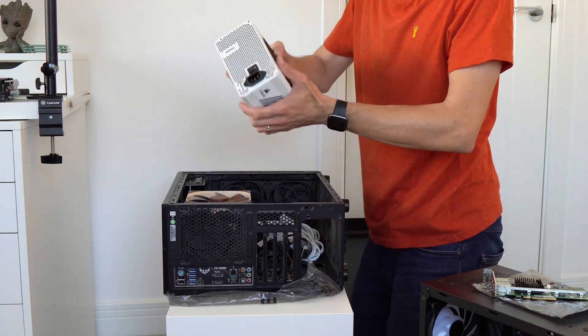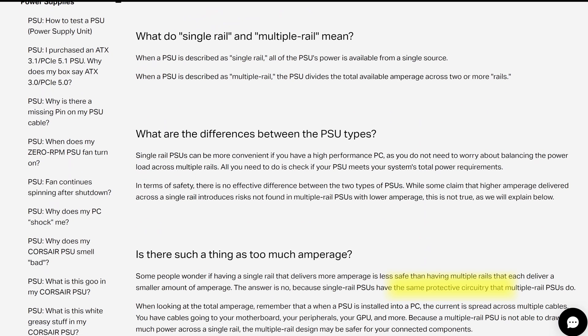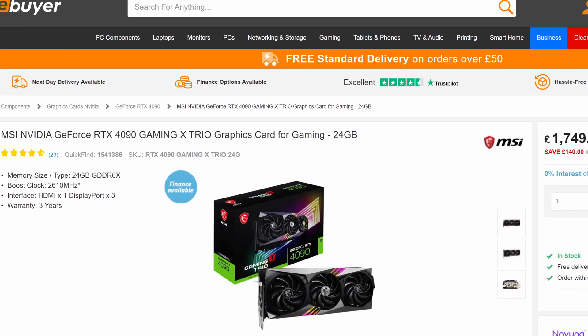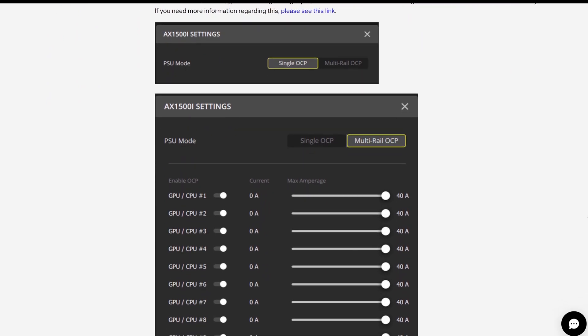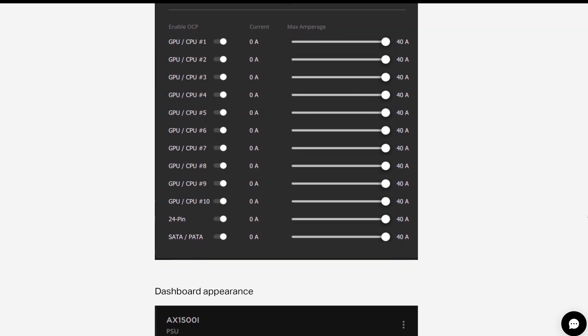But that brings us onto the main question — do we actually need to sell our single rail PSUs and upgrade to multi-rail ones? Aren't they safe after all? Well, Corsair's own website actually addresses this and makes clear that both types of PSUs are safe, explaining that all their PSUs have the same protective circuitry inside them to prevent overcurrent and short circuit issues. And even if you have a fairly powerful computer, like a 12-core CPU and an RTX 4090 GPU, you should be absolutely fine with a single rail PSU. Some multi-rail PSUs even give you the ability to switch back to single rail 12 volt delivery, and various people online suggest doing this if you've ended up with a multi-rail PSU, because some high-end GPUs are quite demanding and this can potentially cause issues for multi-rail PSUs if their 12 volt wires deliver lower currents than single rail PSUs do.